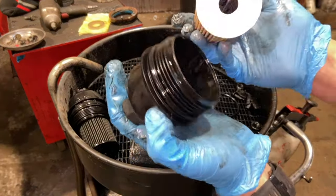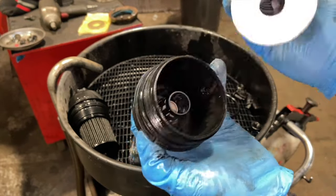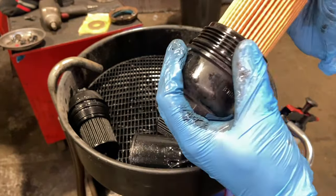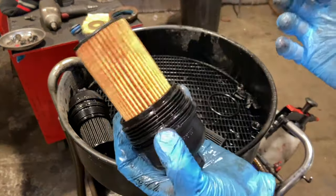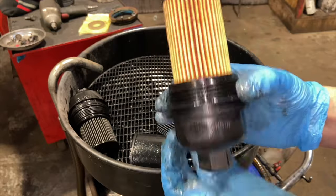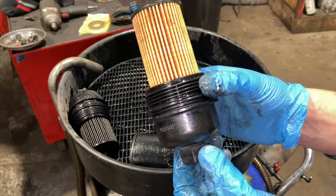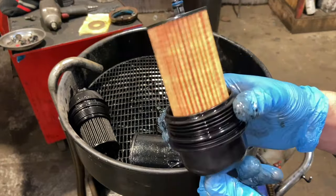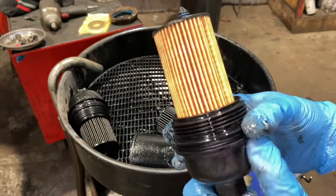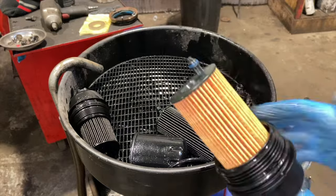It's always nice to give the seal a little rub with some oil so it doesn't snag when putting it back in. Once you've got the seal on, get your housing — your new filter will be quite a tight fit — and just pop it over the ridge; it just clips into place. Now that's ready, we're going to leave it aside while we put the car up in the air and drop the oil. Leaving the filter out allows the oil to run through and drain better, so don't put it back with dirty oil in the top just yet.